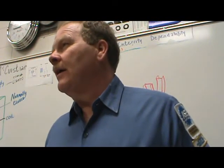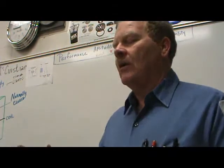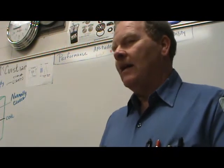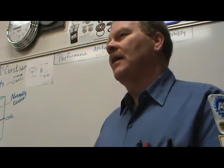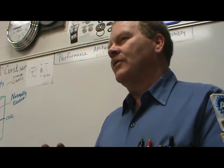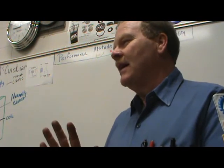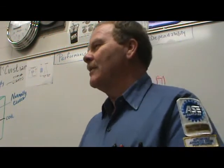And when they get all that done, incidentally, if you pull the engine out of one, and I've seen this repeatedly, that torque converter's hanging there, and you're not even thinking about that. While you're fooling with the engine, that torque converter is hanging on a seal that's been in there for probably 15 years, and it's all hard. It wasn't leaking when you pulled the engine out. Now when you put it back in, you've got a really bad transmission leak.